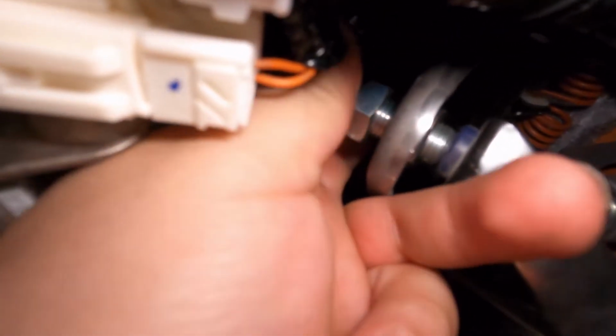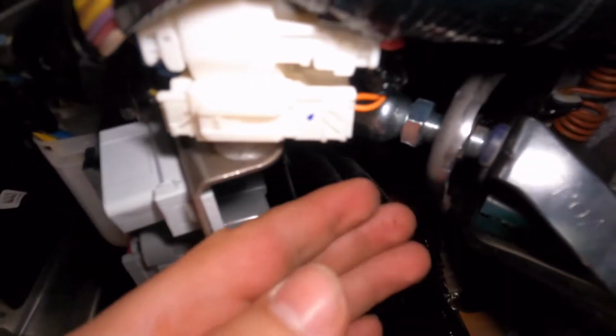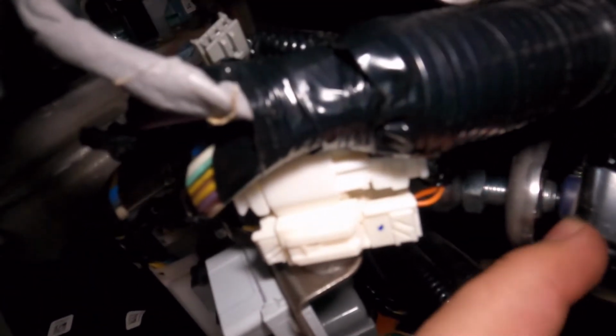So you start twisting that up, and it starts going back in, this whole clutch assembly. Because if you go the other way, clockwise, you start seeing more thread here, and it starts pushing this down more. So if you go counterclockwise, it's almost like removing the bolt. So obviously this starts getting smaller, this starts coming back up, and that's how you adjust it. And my cousin said he wanted about 2 or 3 threads left.